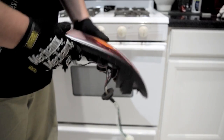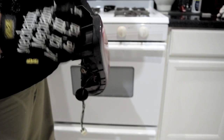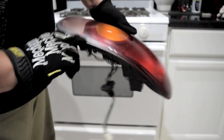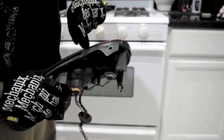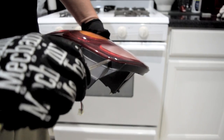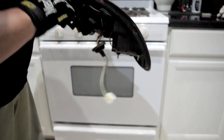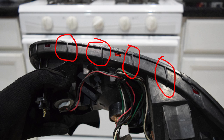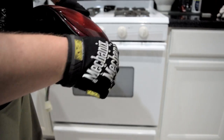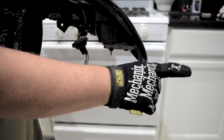While the NB2 light is in the oven, I'm going to show you what we're going to do when we pull the light out, because we want to get the lens off the housing as quickly as possible while it's still hot. There's a lip that goes around most of the taillight, but right here where there's a little flap that bolts on the top of the trunk area, the lip doesn't cover that area — so that's where I'll start getting under it. Also, the light is actually curved quite a bit, and on the bottom there are lines in the molding — you want to be parallel with those as you take the lens off.